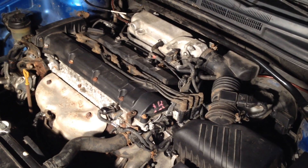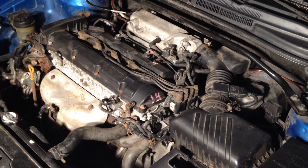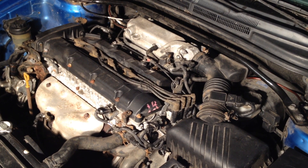That would also be explained with this. We're going to go ahead and clean the idle air control valve, as we think that's what the culprit is, and see if that will fix it. Let's get doing that right now.